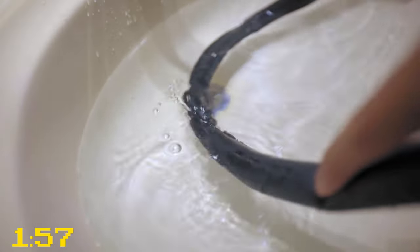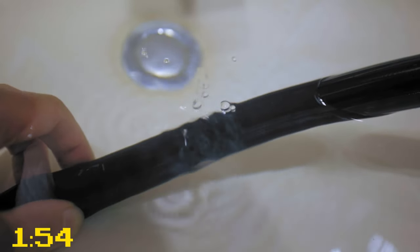But if you're at home and you want the most surefire way of finding all the punctures possible before you patch them, so you don't have to redo all of that work, the best way is to pump up the tube a bit and then submerge it in water and see the bubbles blowing out of the punctures.